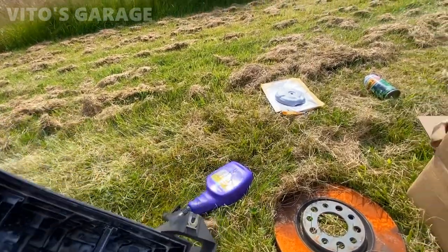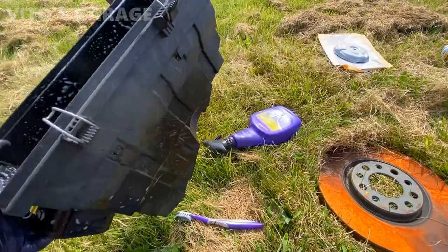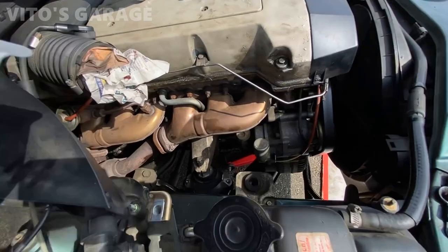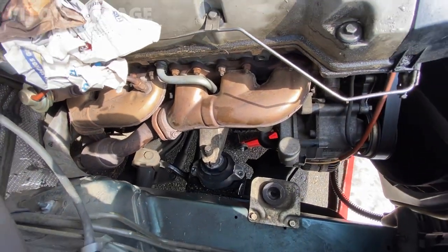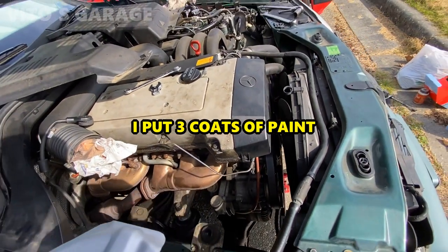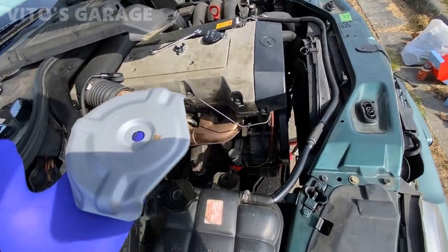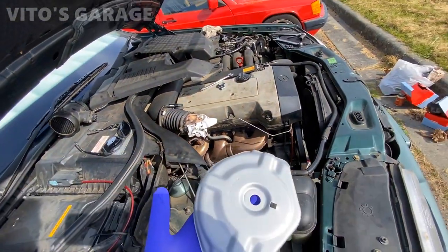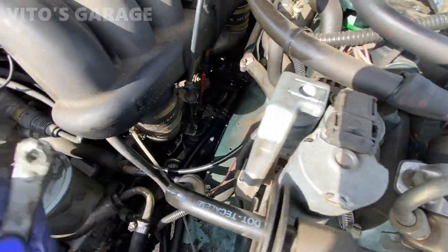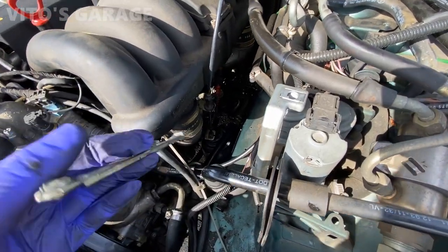While the paint is drying on that heat shield, I'm cleaning up all the air boxes to make everything nice. I went ahead and cleaned and sanded the heat shield slightly, then applied some high-heat paint. The new mount is already in place, so now it's time to put this on and bolt everything back together. I lowered the jack and the engine - we're almost done. I'm also lubricating and cleaning up all the linkages while I'm here, so it's gonna be all nice and smooth.